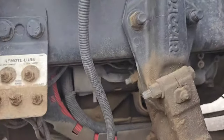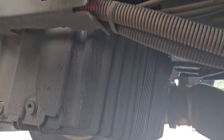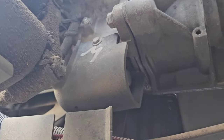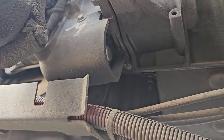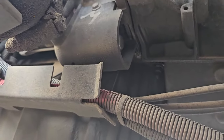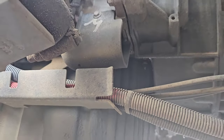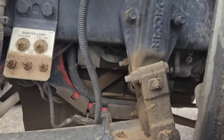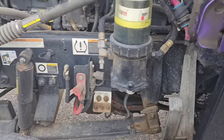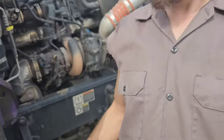There's more oil — it looks like it's on the other side even more than what I've seen on this side. It's just covered in fresh oil. And that oil pan bolt — I don't know if you can see it or not — it's totally missing. You can actually see it dripping down that stud right there. I'll have them fix that when it gets to the shop.